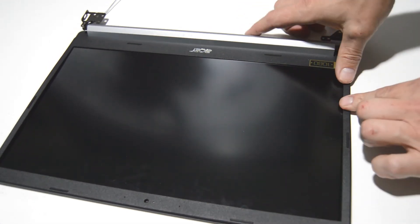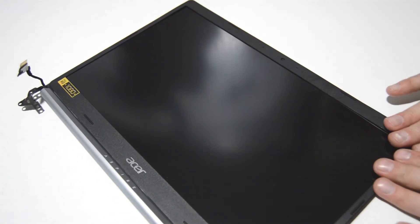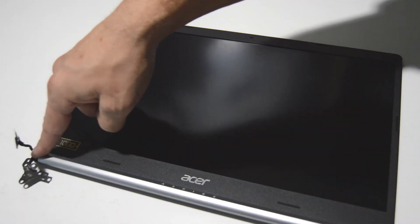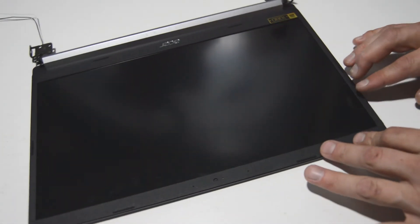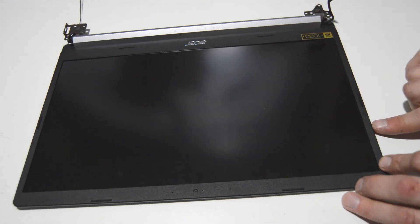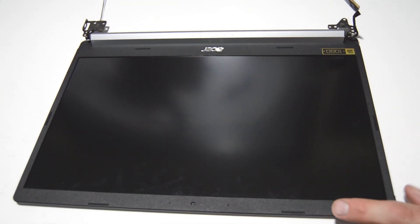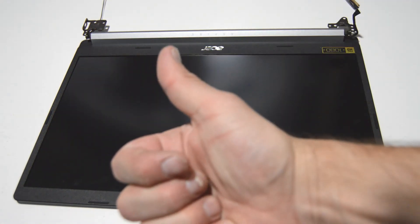As I said before, the screen assembly is going to be kept complete, but I just wanted to give you a heads up on how to remove that bezel. Once you remove the bezel you should be able to get to the hinges if you need to replace them. As far as the LCD — if your LCD is broken, I would definitely recommend against trying to replace it yourself because it's going to be pretty difficult on this model. So that's how you disassemble the Acer Aspire 5 series — this particular model is the A515. If this video helped you or you found it informative, please like and subscribe. Thank you.